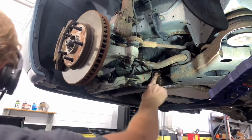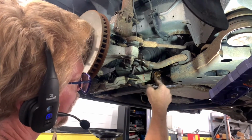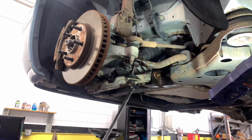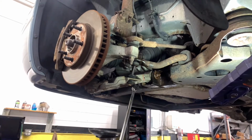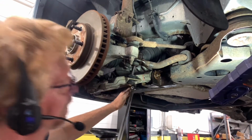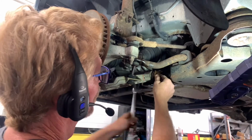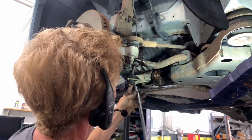Now these two on this side, you've got a nut with a stop on it, and on the inside they're 18 mils. Long ratchet right here. And you'll see it hit its stop, and if it goes well, again, this will come out of here. It does need some other work. Now hopefully these bolts come out of this arm. If not, that'll be a whole nother story.